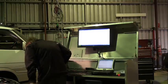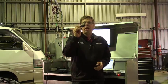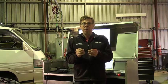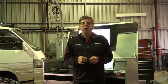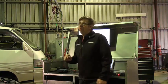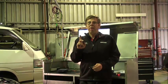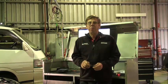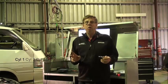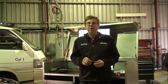I've made sure I've turned it on. I'm using two channels today on my scope. Channel A is going to the coil to check the primary pattern — not really to analyse the pattern itself, but to find where number one cylinder is firing. When channel A triggers off that trigger point — a yellow star above the voltage line — we start our pattern. You'll see the cranking waveform go up from the amps, and you'll see the spike from the high voltage coil, which gives us the position of number one cylinder. We know the firing order is 1, 3, 4, 2, so we can identify which cylinders show low compression.